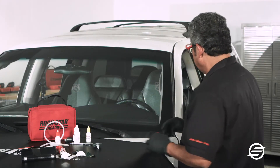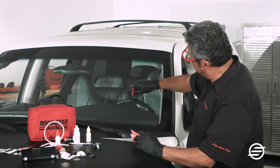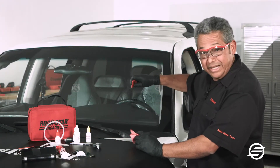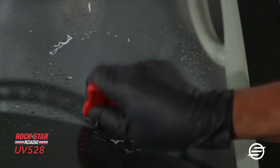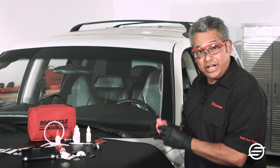I'm going to use a little bit of water and sprinkle it over the area, then scrape the resin off the surface of the glass. When I scrape it, I don't want to use an indirect angle like 45 or 35 degrees — I want to come in at 90 degrees and actually scrape it off. Now that I've scraped that off, I'll wipe away the moisture and residue of the dried resin.